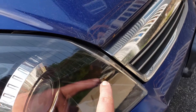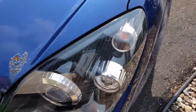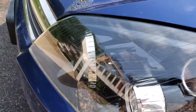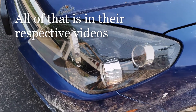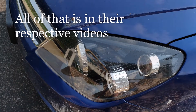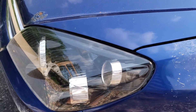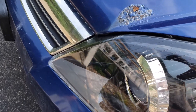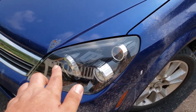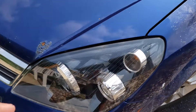There are a few runs in the Sylvania one and a few runs in the 3M one as well. With both of them I screwed up equally — I put them on and then hit them again. But you can see they both came out very good, they look excellent. A lot of it is the time that you take when you do it. I highly recommend using as much of the sandpaper as you can and getting the headlights as clean as possible, because it's only going to make the end result look even better.